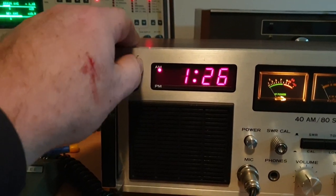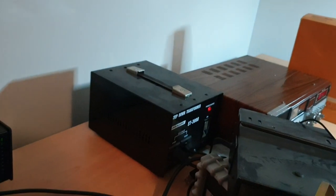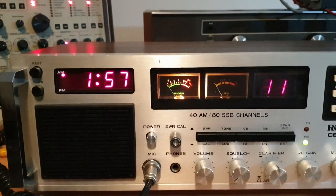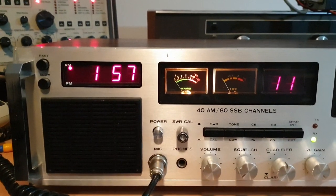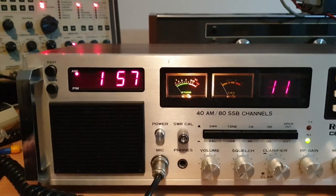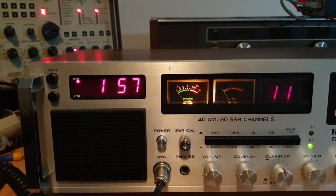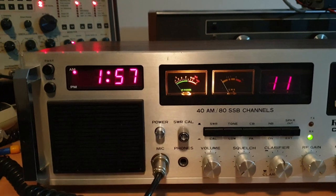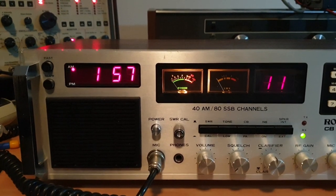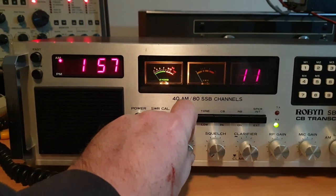Okay, so you can set the clock, slow, fast, etc. I'm running off a 110-volt supply with one of our little step-down transformers, so the question is whether the clock is going to be completely accurate — 60 Hz versus 50 Hz. Probably not. Michael did a conversion on a GE Super Bass where he got it back to 240 volts, and what's hard is getting the 50 Hz to work on the clock to get it totally accurate — you've got to give him credit for that.